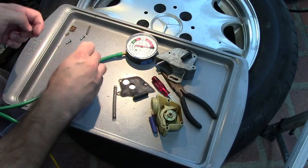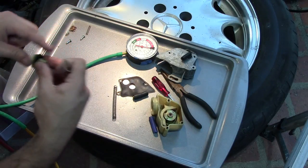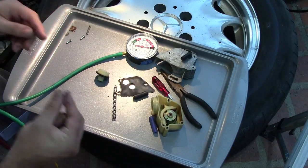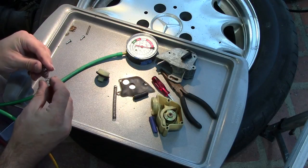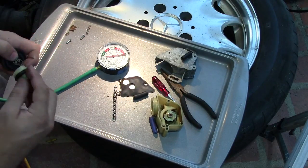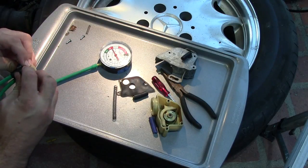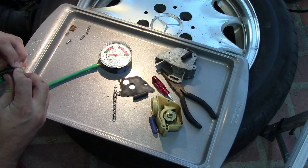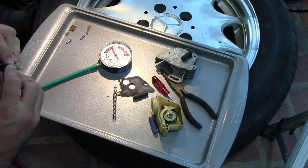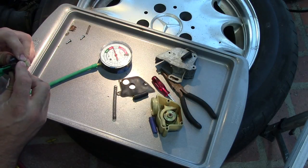What I've discovered is that this piece moves like this, not against its stop. And that this spring — which was one of the originals out of the B1 piston in the valve body of that car — fits inside the original spring, fits in here. If I can squash all this together: 15 inches at idle, and it still goes right to zero when you push it in. I think that might do exactly what I want. I'm going to go ahead and put this in the car like this. It's a reversible modification, and we'll go from there. Thanks for watching.